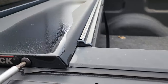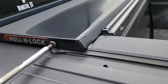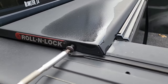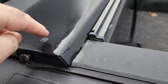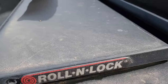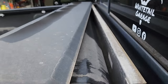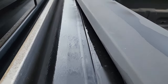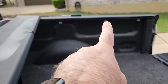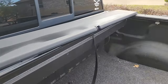To be clear, I wasn't the one that installed this cover, so I'm not sure of the order of operations I need to follow to uninstall it. To gain access inside the canister, you take out a screw on either side and that lid slides off — you need to do that before you can get to the side rails. The cover slides back and off. I've got two screws here, and then underneath the bed rail you can see the clamps that hold it on all the way down. That should get the rails out, and then the canister can come right out after that.